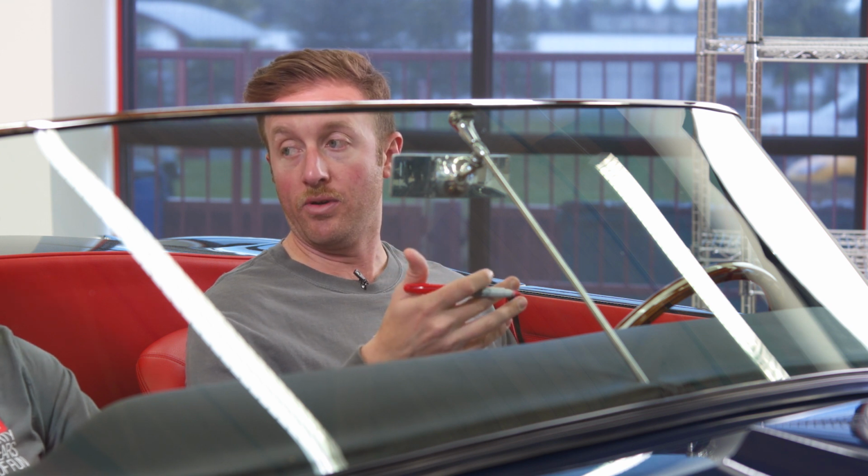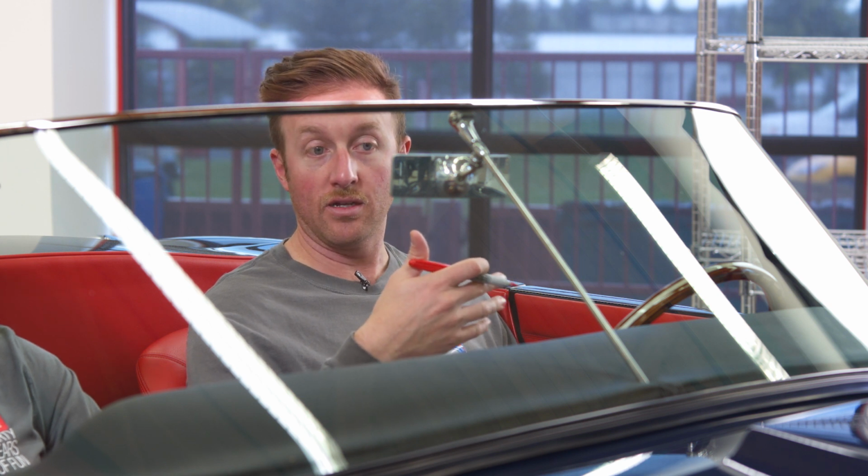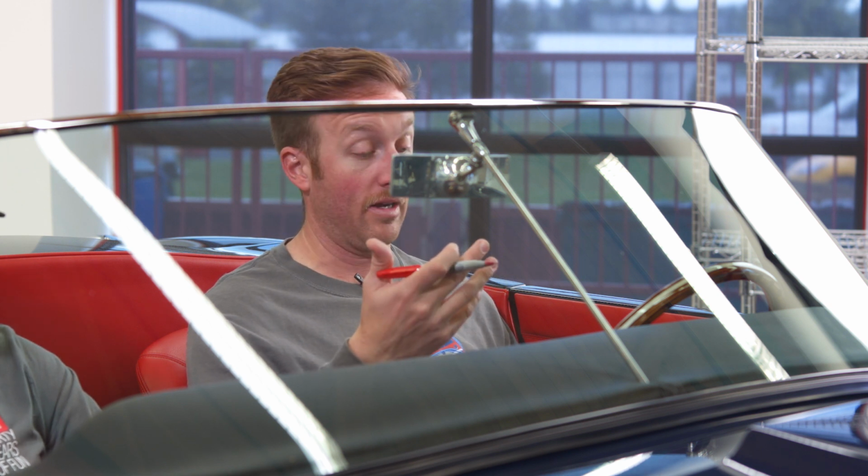Yeah. But this is the beauty of our system, is that you can tune these things to specific paints and your own processes. But Boss Fast Correcting Cream is substantially more aggressive than Correcting Cream, so it will be detuned less by a softer pad than Correcting Cream will be increased in aggression by using a firmer pad. Yeah, I would definitely agree.